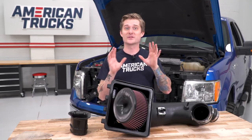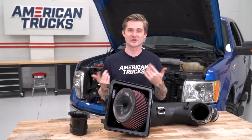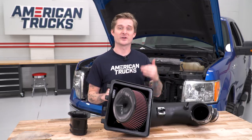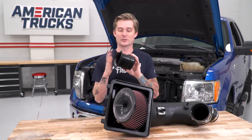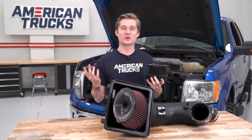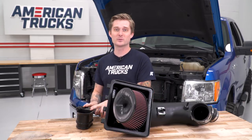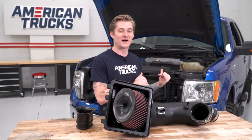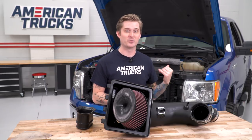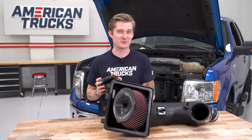We're finally ready to install the new intake. Quick install note: the instructions mention pulling out the factory duct and replacing it with the new duct, but after doing measurements, the factory duct is not really any smaller than the new one and will work just fine with your new filter. So if you want to avoid the hassle of removing the bottom of the factory airbox and getting all those bolts out of the fender, you can avoid that entirely — this step is technically optional.